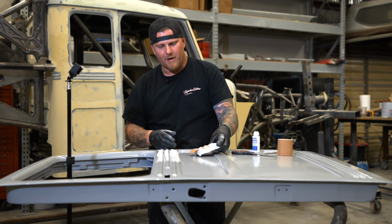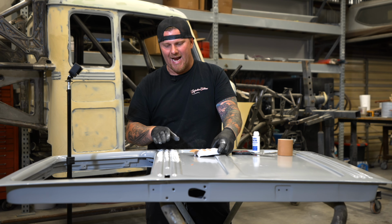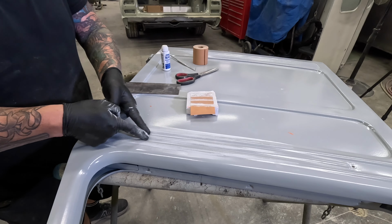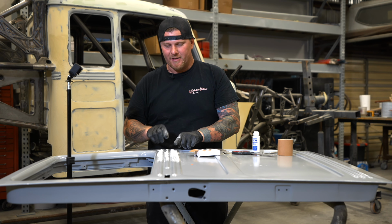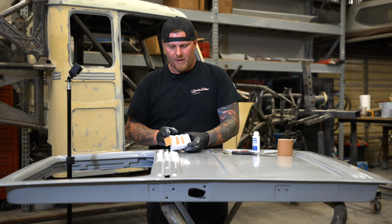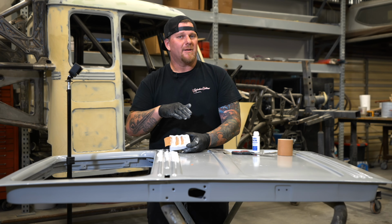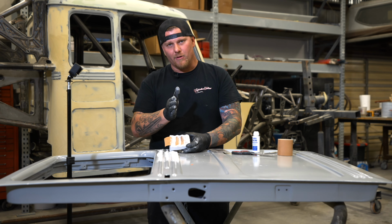It may or may not be hard to view on the camera, but we're hitting almost exactly where I wanted to be hitting. On the car, the bottom lows of these Vs is the issue that we're having blending out to the flat. What's nice is this is touching first the outer edges and the top. Now what I'm gonna do when I get to the final is I'm gonna cut the edges off so it's not sanding the flats. We spent the time to make the flats even with the car. The last thing I wanna do is wear a groove right into that.